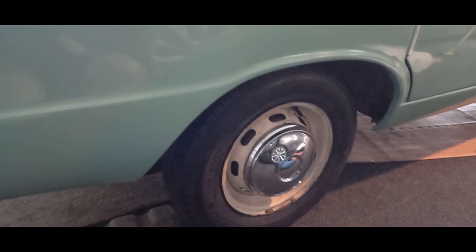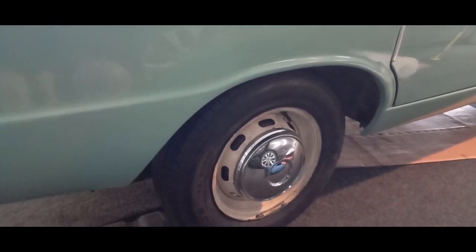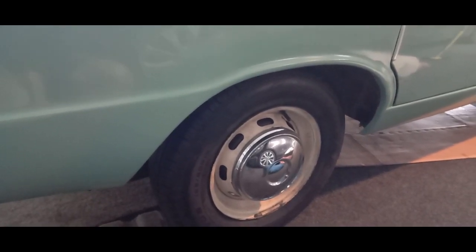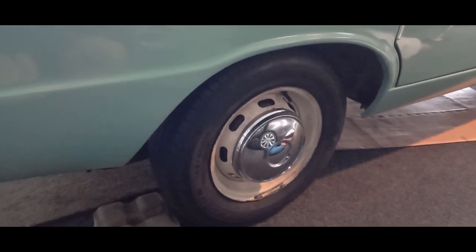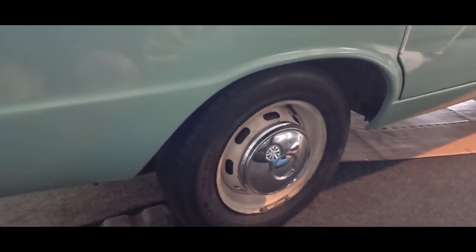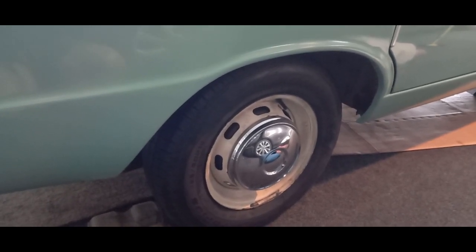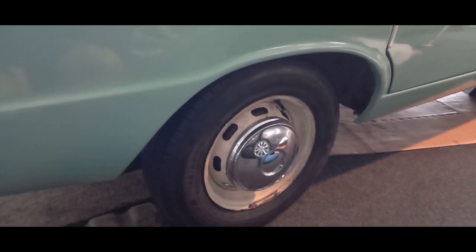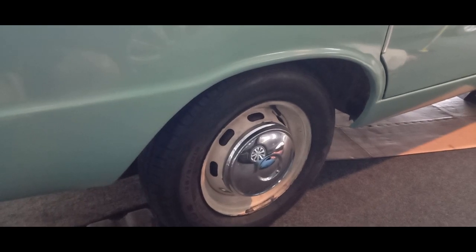In previous videos I rebuilt the rear brake cylinders. I noticed when I changed the differential oil that the right rear brake was jammed on after I released the handbrake, so I stripped them all down again and lubricated all the internal seals and cylinder bores with rubber grease. I haven't had a problem with those brakes since. So I'm thinking there's the same problem with the clutch slave — not enough lubrication around the seal — and hydraulic fluid is being forced past the seal and out of the dust cover.